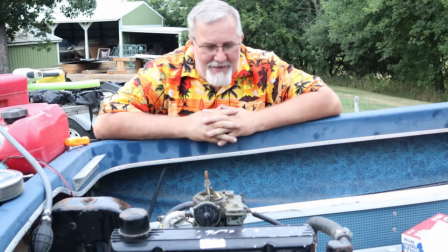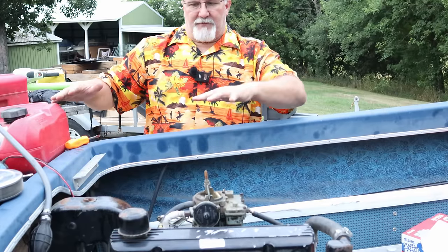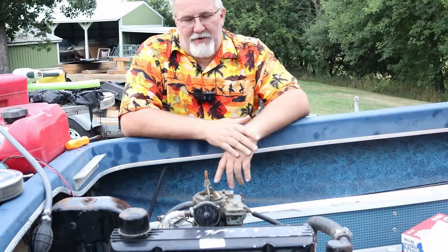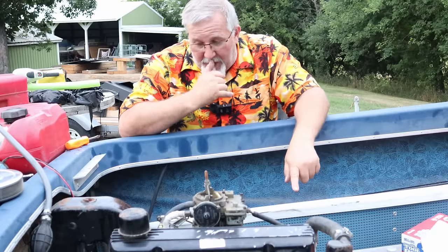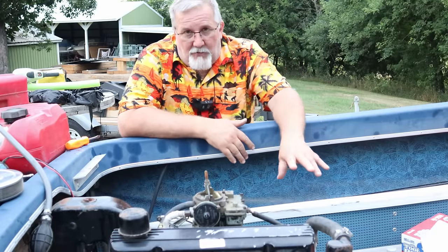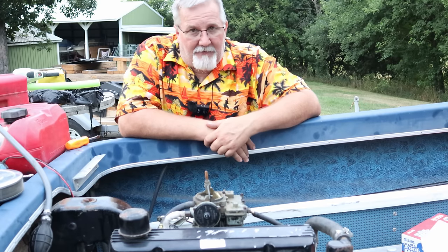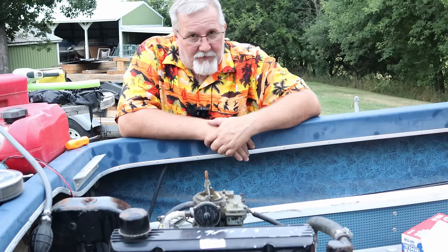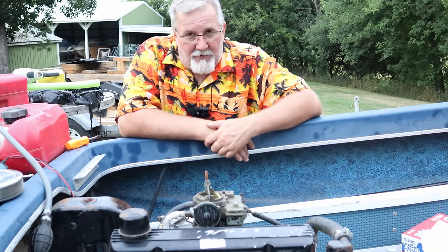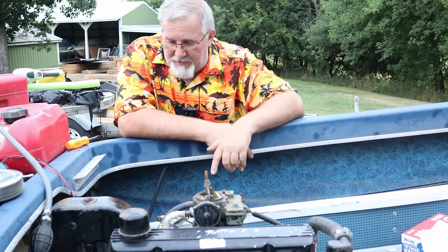The transom, it's funny to look at it because the engine's kind of angled down and the stuff on the back's angled up a little bit, but it's just opposite of what it should be right now because somebody has taken the front motor mount out of it. Because it was basically rotted away. And I'm glad the guy never got this in the water because I think he'd have been in for a rude awakening when he went to throttle it real hard or turn real hard and it just ripped the back of the boat out, because the whole transom's just rotted.